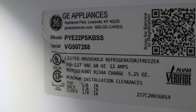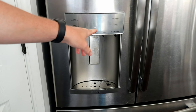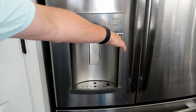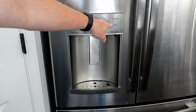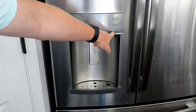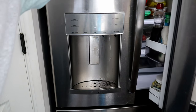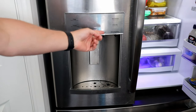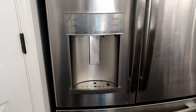So there's your model number: PYE22PSKBSS. Typically how this works on this particular model, you put your K-Cup pod in here, press the start heating button. Once it heats, you select the brew size, then hold down brew dispense and it will dispense out whatever brew size you selected. But when I press the start heating button it does nothing but just pour water out of the brew dispenser there. It shouldn't be doing that — I just opened the door real quick to stop it, and that's part of the problem.